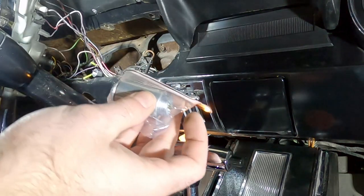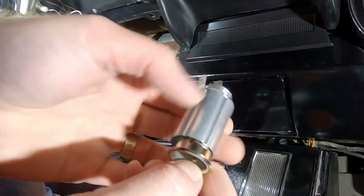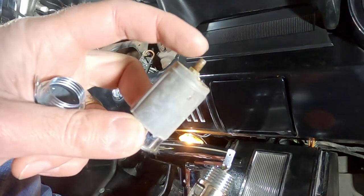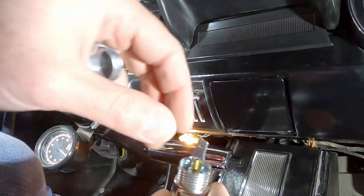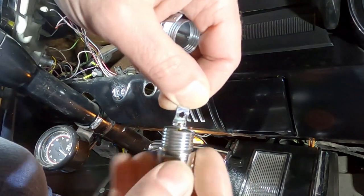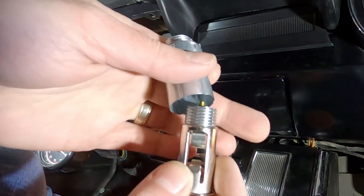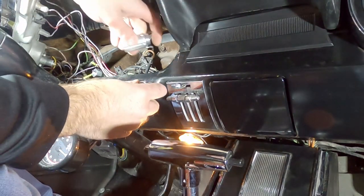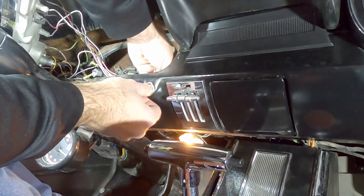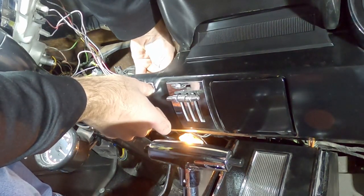Now we can go ahead and install the new one. Once you get it out of the package, disassemble the two halves by unscrewing the back piece. This new one comes with a tab, and on my stock one there's a post that the terminal goes through — that post is still there. So we're going to spin this tab off, leaving the post so we can put that wire back on and everything will still fit in the car. Put the housing in first from the front, then go to the back side, put your thumb in the middle to hold it in place, and screw the back piece on tight.